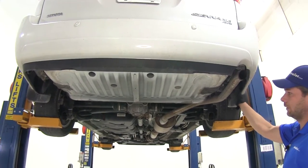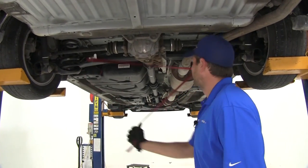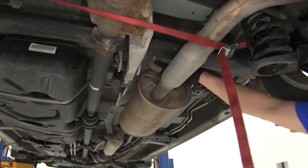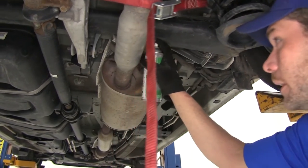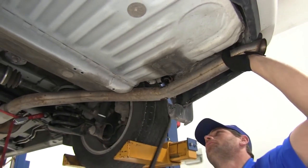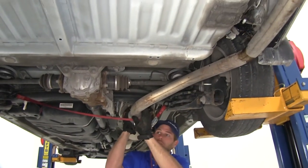To begin our install, we need to get our exhaust down and out of the way. We're going to take a support strap — you could use wire, I've got a cam buckle strap here — and run it from side to side underneath the exhaust. We'll tighten it up just a little bit to give us some support so we can control how far down the exhaust comes once we remove the hangers. We'll have two hangers in the front, one on the driver side and one on the passenger side of the pipe. Spray those down with some lubricant, and then use a pry bar or a screwdriver to remove them. This should give us enough room to get in there and work.